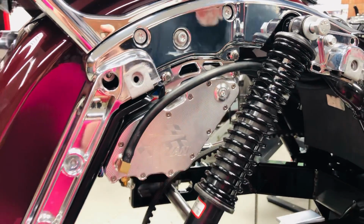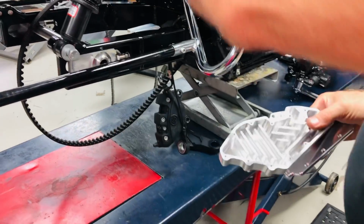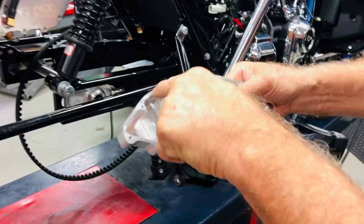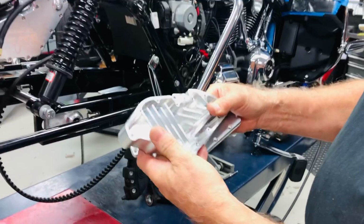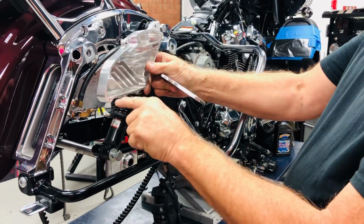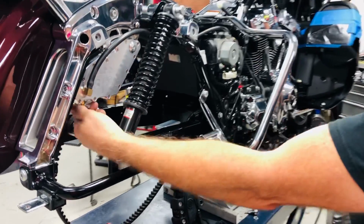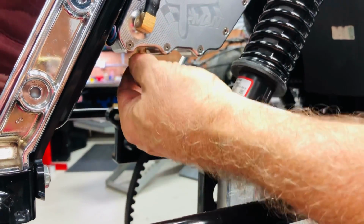And the way it's designed, it has a front plate on it, which you can see right here, which screws on. The vent off of the oil tank comes in, and it has to run through all these little channels, and that breaks up the oil mist and the oil. And the way it's located, everything runs back to the bottom here. As you can see on the bottom, we have a drain so that you can drain these things and you don't have to take anything apart. There's a nice little drain on the bottom.